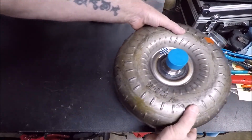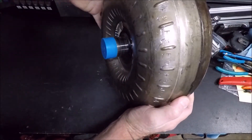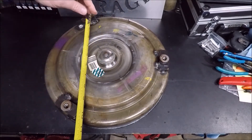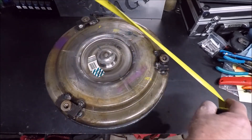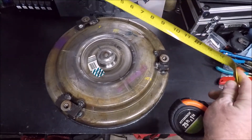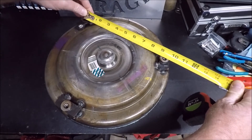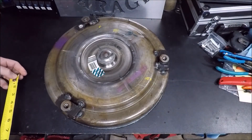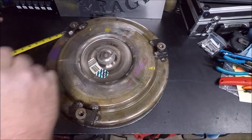So to show you what I mean, we've got the old torque converter out of the China Vet here. We're gonna flip this guy over — probably get trans fluid all over my workbench. There's the problem: if you try to measure it like you do a lug pattern on a car and go center to center on here, you're gonna come up with about nine and a quarter inches, which obviously is not correct, because as I just said, GM never made a torque converter with a bolt pattern that small.